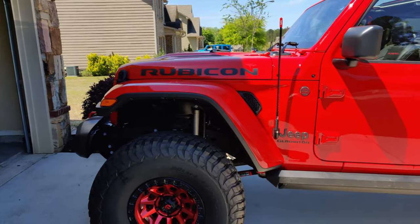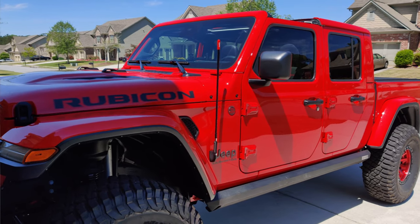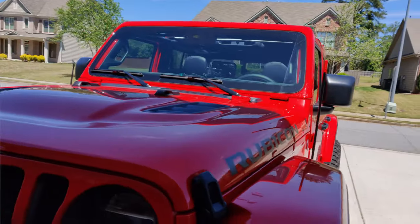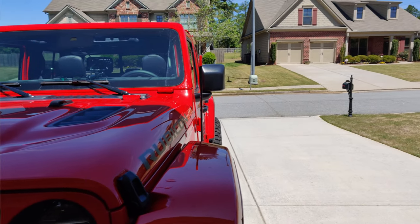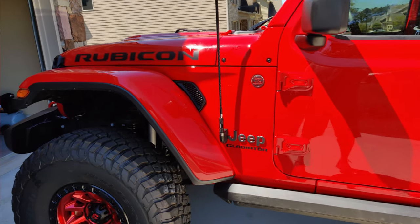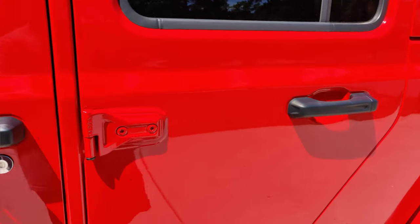The location is perfect at the front. I may decide to add a three foot antenna which would be right at the roof line — maybe a tiny bit over, but it wouldn't really interfere with clearances. I'm going to wait and see what reception I get first, because I'm not under any false pretenses that this thing is going to go two to five miles. You really need a super tall antenna for that. The only reason I wanted a CB is for communication on a trail with other Jeepers. And once you loosen the fender bolts and pull the fender back slightly, the flare pops off just like that to access the mount.